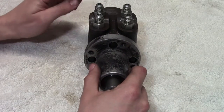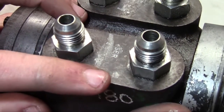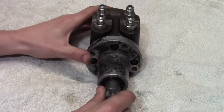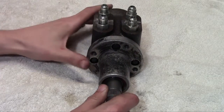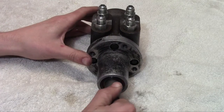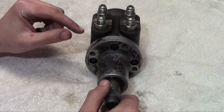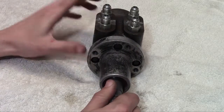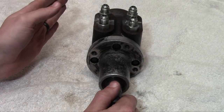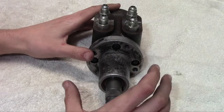Then you get into your L's and R's here. As you can see, we've got those highlighted out — the R right there and your L right there. Simply put, when you're turning your wheel to the right it pressurizes the port labeled R, and turning your wheel to the left pressurizes your L fitting. But when you want to turn right, that means you need to pressurize the left side of your steering ram. Turning to the left pressurizes the fitting going to your passenger side, which throws your steering ram to the driver's side, allowing you to steer that way. So just remember: you're pressurizing the opposite side that you're turning.